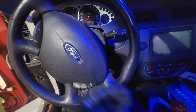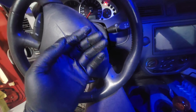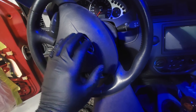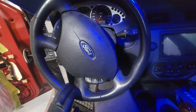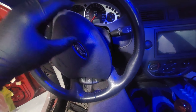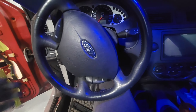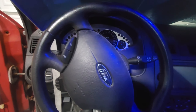For air, I don't think I have an issue - everything is plugged in and it should be sound on that front. The fifth thing I'm looking at is the wires - making sure there are no cuts in the line, checking the pigtails and wire harness leading to each of the spark plugs and coil packs. I didn't see anything that would stand out. Back in the car, one thing I noticed when I put the 2.5 in and when I put the 2.3 back in is that the PAT system flashed.